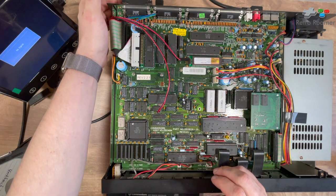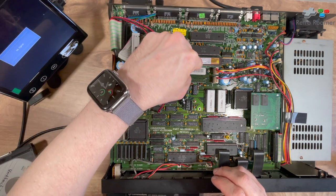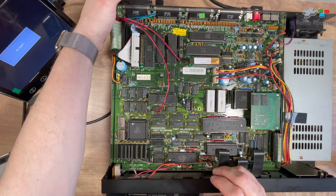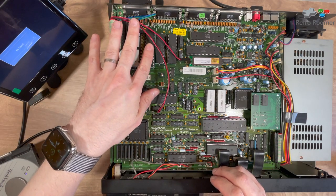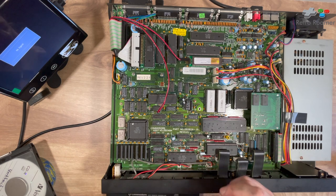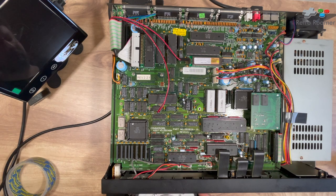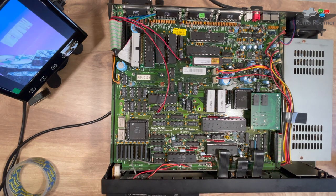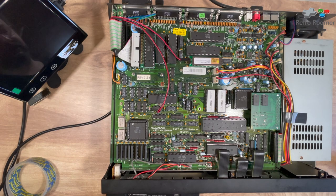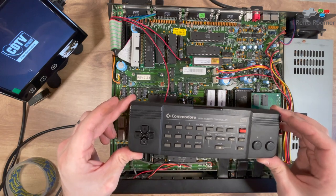So I've literally got left hand side switch is for the ROMs on and off, right hand side switch is for ROM switch, and the button just below the VGA connection for 15 kHz is the on-screen display for the RGB to HDMI. So if I now turn him on and boot him up, you will see a HDMI picture and it will boot up into 1.3 as a 1.3 ROM with obviously the extended all built in, and I've got the funky remote.